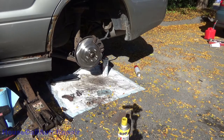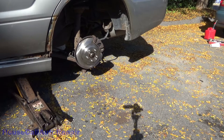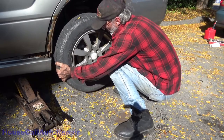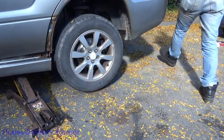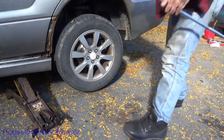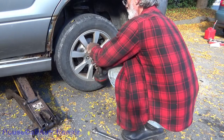The construction noise is all gone now. We'll get everything cleaned up on this side and get it moved over to the other side of the car. Go ahead and put the wheel back on. The car is currently missing a lug nut — in this video I actually steal one from the other side of the car since we only have four over here. We'll get these snugged down — not tight yet, you still want a little bit of looseness in these, and I'll show you why.